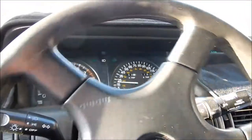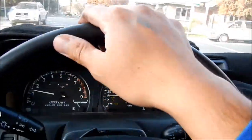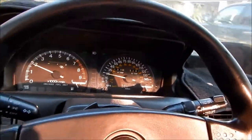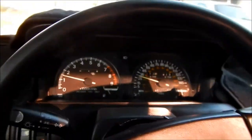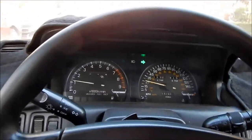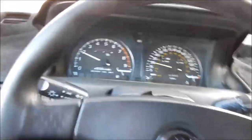Let's drive it around the block. The low fuel light went away, so my Galant is just low on fuel. It was parked on a crown at an angle where the fuel would be away from the pickup. Maybe the float got stuck or something. It says we're pretty close to E — I've got 159 miles on this tank, pretty bad gas mileage. I did lose maybe a cup of fuel taking the fuel pump out. We're about a quarter tank, which is about what it was before. So the fuel sender is working and we are not that low on fuel — we just needed to get the fuel moving around in there.